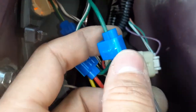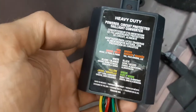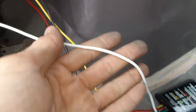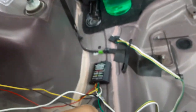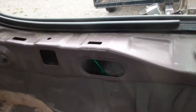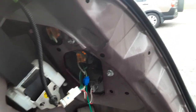For the brown wire — brown is tail — that goes to just the solid green wire. For the ground, I cleaned some of the paint away here and put it right to the tail light housing. For the right turn signal, I ran it through this part of the unibody here, right out the hole and right over there. It's the same color wire — the green wire with the yellow stripe.